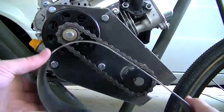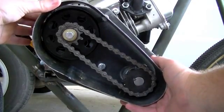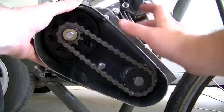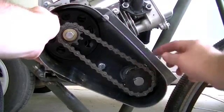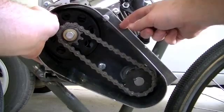Alright, so here's our bracket — or I'm sorry, our shroud for our clutch and chain. It's going to mount on there something like that. And I think what I'm going to do for mounting is bend up some more of this 16-gauge. I'll cut a little strip about 2 inches wide, bend it halfway, and it'll weld to the shroud and then bend up 90 degrees.